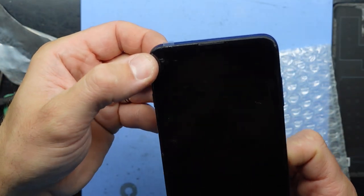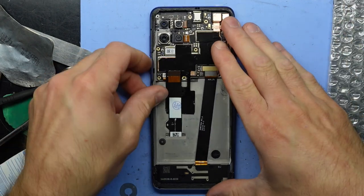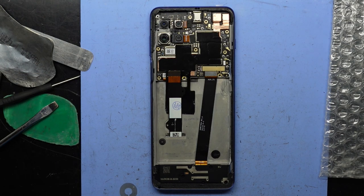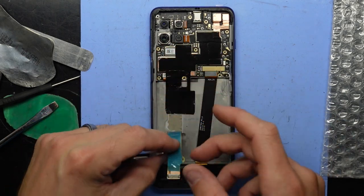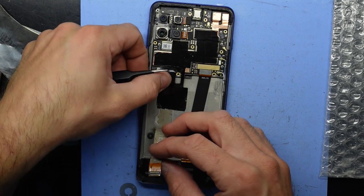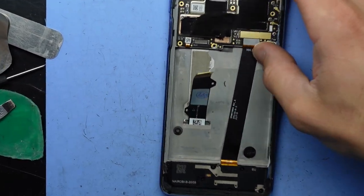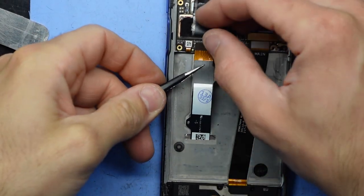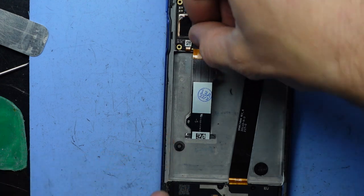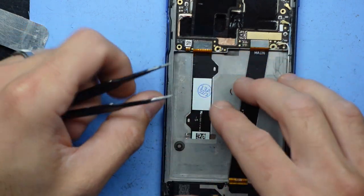Right now we're looking alright all around. It feels like it's slotted quite in the groove and there's no wiggle room if I try and wiggle it side to side. Mesh is still there, cameras are still there. I see two cameras — we're looking good. Now from here I'm going to lay this down. I've already swept it for glass shards so there shouldn't be anything there. We'll connect up the screen — fold this over and have a look. I'll line it up over the top, use my finger to hold it, and I'm pushing it left and right and it's not really moving — so that's how I know it's connected. Just push down after that and that should lock it into position.